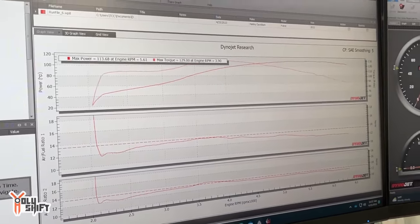After the manual tweaking, we came in very close to what we had before. But we're going to tweak a little more manually — add a little bit more fuel because it's running a bit weak between 3 and 4. So we're doing that again and sending the new tweaks to the ECU.